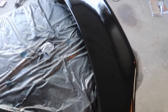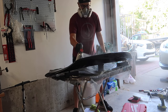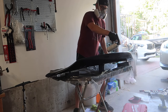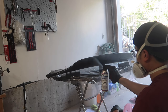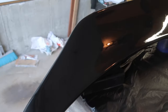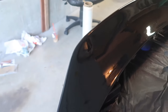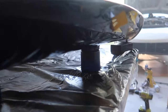On the next coat I'm going to be using a heavy coat — this is the second coat of clear, so I'm going to be going pretty wet with this. I laid this one pretty wet. As you can see, it's very glossy, and on the underside you can see it's very glossy as well — you can see the reflections.